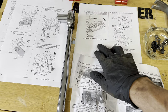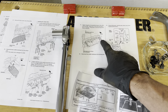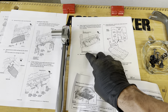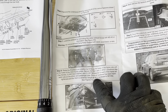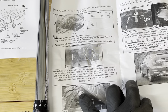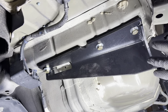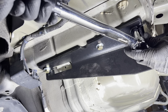As far as tightening the bolts all the way down — the Honda trailer hitch instructions say to tighten those six bolts to 46 newton meters or 34 foot pounds. But the TorqLift Eco Hitch manual says to torque to 38 foot pounds. Since we have the TorqLift hitch and their hardware, I'm going to go with the 38 foot pound setting. I'll dial that in now — the torque wrench is set to 38 foot pounds, so we'll tighten these down to spec.